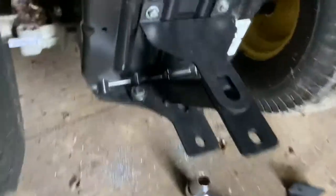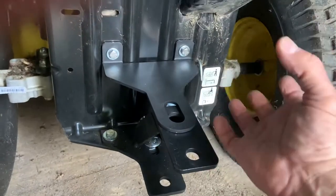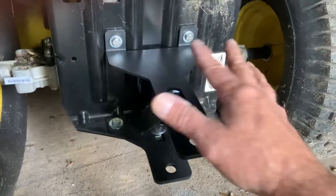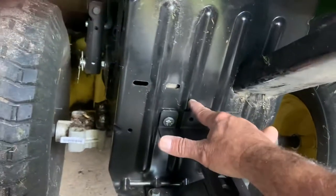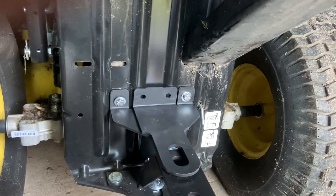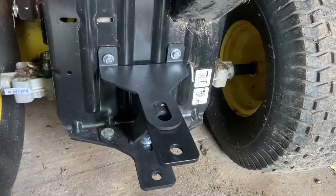I hope that helped anybody trying to decide how to put this on. I could have flipped that upside down and made the bolts lower, but I thought the further up, the better for strength, so I didn't flip it over. I could have made the bolts easier to get to from the bottom, but let's go up as high as possible for leverage. I may add that second plate, but on this rib it's really not going to help much — if you crank it too tight, you'll flatten the rib and weaken everything. So I'm going to leave this plate out. Look right between the ribs — perfect. Hope this helps somebody. I'm not a mechanic, just a guy like you trying to get stuff done.